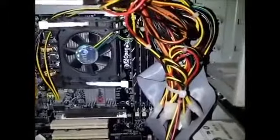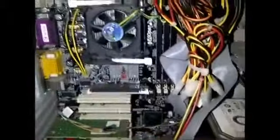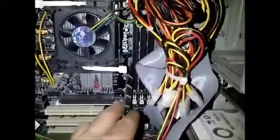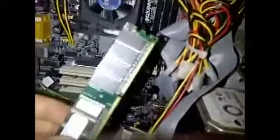Take one RAM chip and put it back in closest to the processor, and click it into place properly. Then try turning it on. If it does not turn on, pull that RAM chip out and try another one. If you only have two and neither works, try the second slot. If there are different colored slots, definitely try the other colored slot, because on some motherboards one side or the other can die.